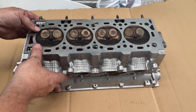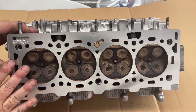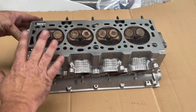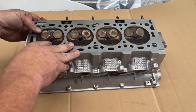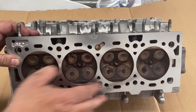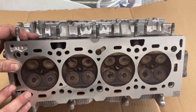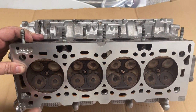Now I've got the cylinder head back from the machine shop — this is something I can't do myself. They have machined it, vacuum tested all the valves, and pressure tested it, so it's not cracked. The valves are all sealing well and it's now all smooth here. The valves haven't been removed — that's exactly how it came out of the engine. I haven't even removed the spark plugs, so you can be a little bit lazy and leave them in if your machine shop is happy. They're essentially just decking that surface for me.